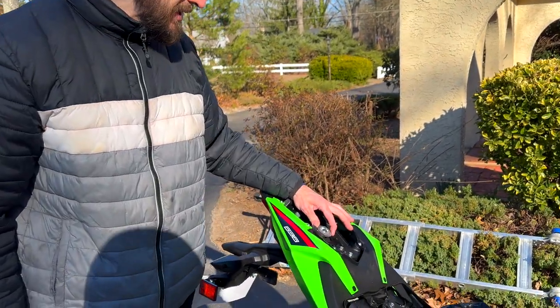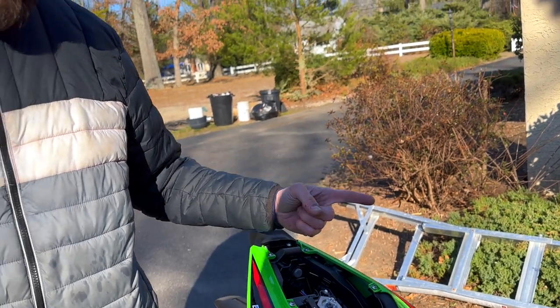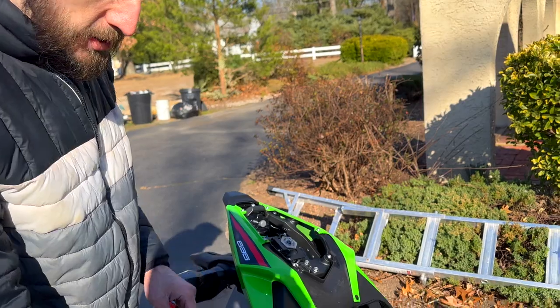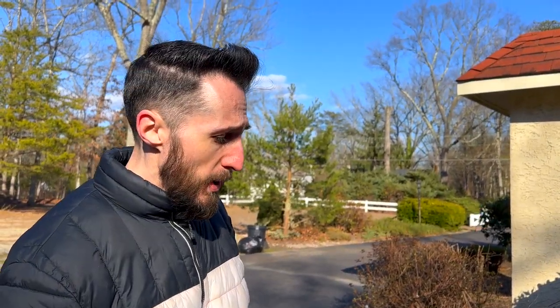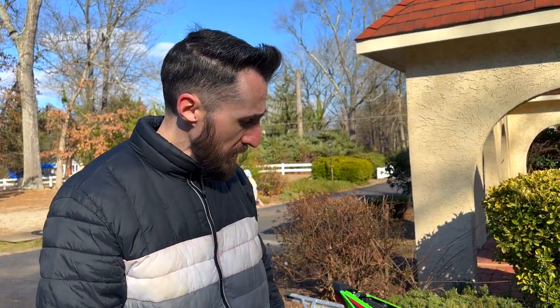I think you're gonna wanna leave the servo cables on. I'm not sure if that's the reason why I don't have a check engine light. I'm really not 100% sure. But a friend of mine said that leaving the cables connected prevents the light from coming on. So leave them connected and just tie them off like I'm doing, until you can afford a servo buddy. So if you can't afford a servo buddy for $60 and an exhaust right away, then you can do that. Tuck the cables or leave them connected to the servo motor and just tuck them away.